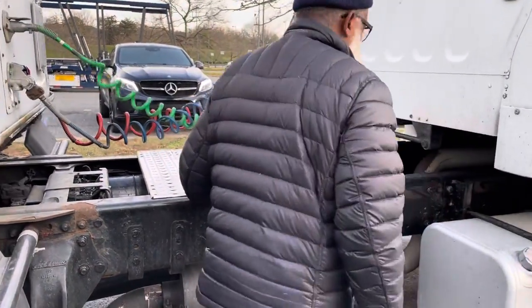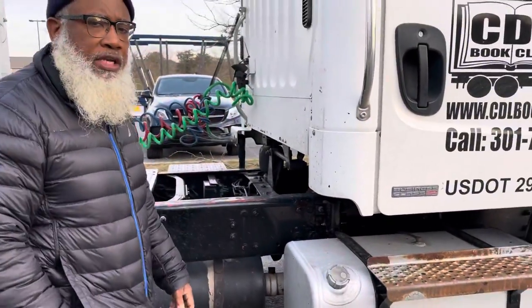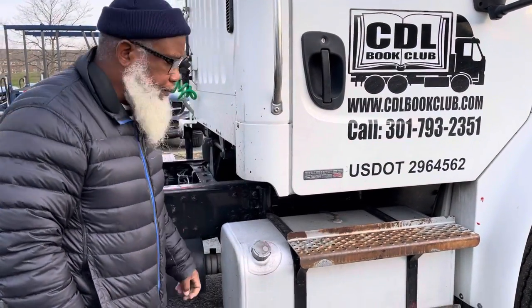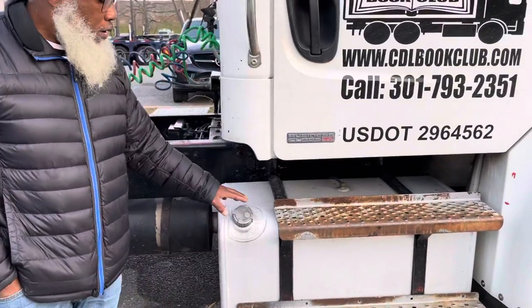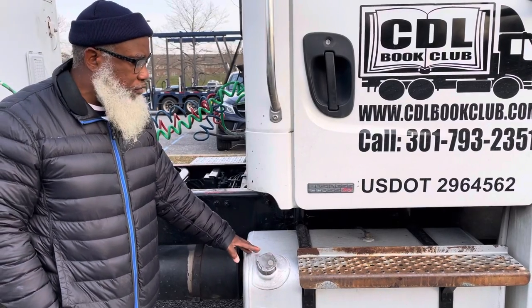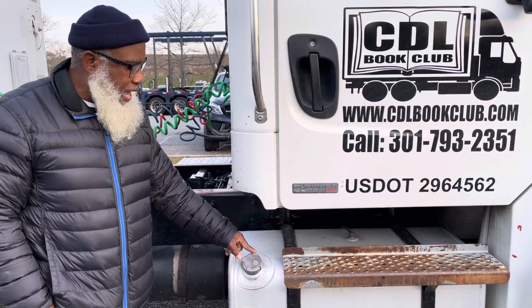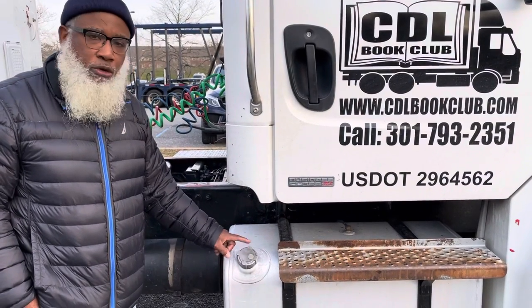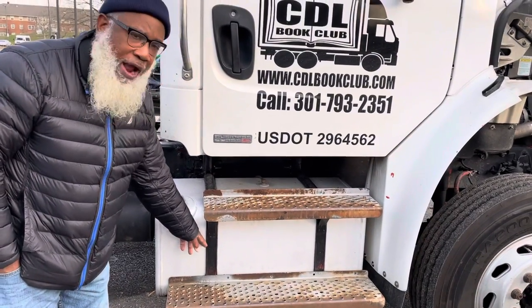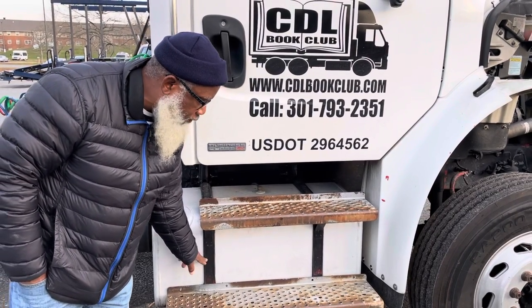My catwalk and steps are not cracked, not broken, and secure — no illegal welds, no loose or missing parts, free of debris. The fuel tanks on my passenger side and driver's side are not cracked, not broken, and secure — no leaks. They have a metal cap with a rubber seal and metal chain. The fuel tank is held up by metal and rubber straps — not cracked, not broken, and secure — no illegal welds, no loose or missing parts — not dry, rotted, or frayed.